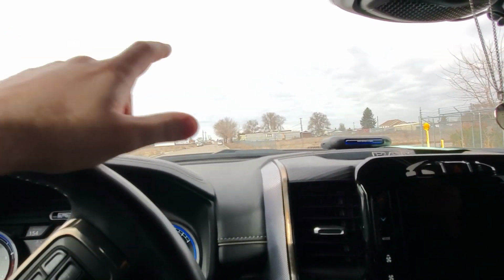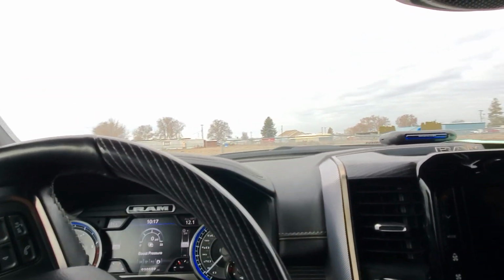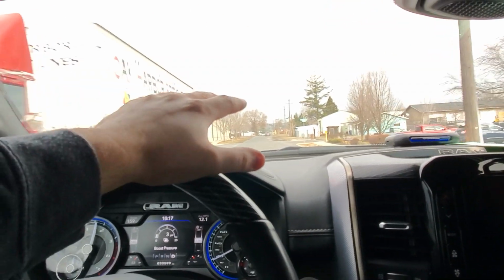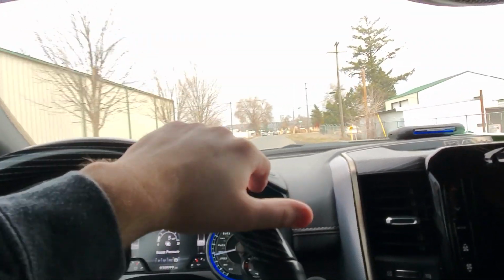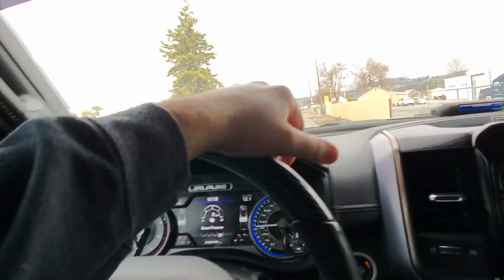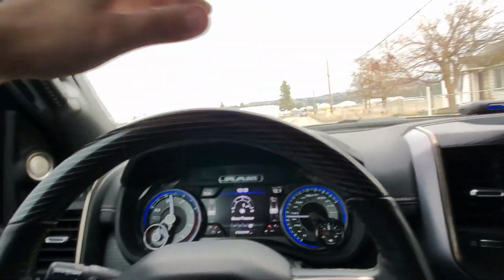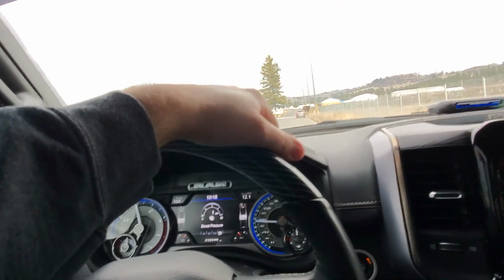So the bottom line is, I did 3/4 up on the passenger side. The reason for that is whatever calibration or puncturing in the hole, something's off to where the driver's side airbag was rock hard. It was really hard on the left side, but the right side was really deflated. So to revise, if you put both of them up like I first did, indicating to the computer that your rear end's too high, it'll try to drop it, but for some reason the driver's side airbag holds all the weight. So to aid that, I dropped the passenger side a little bit, so the pressure came off of the driver's side and went onto the passenger side, and I'm pushing 44 1/4 as we said right now.